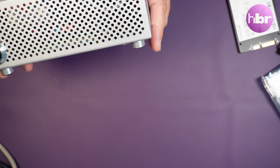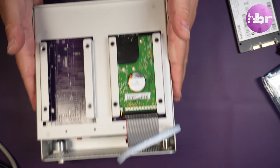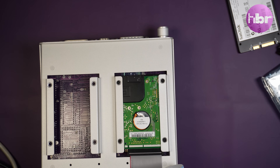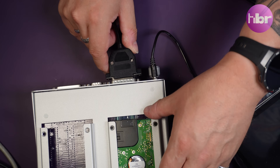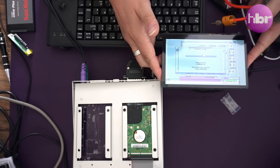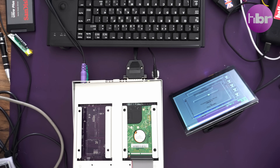With the Denise loosely together — because I'm not putting any more screws in until I make sure this hard drive is at least working — this will be the first time I run Sysinfo on the Denise once I've installed the 68030, and that revealed an interesting surprise I wasn't expecting. In theory this should be absolutely identical in parity to the original 500 Plus hardware it's based on. Before we get to that, let's install Amiga OS on this fresh hard disk. Switching it on and installing Amiga OS 3.2 — the hard drive works perfectly.